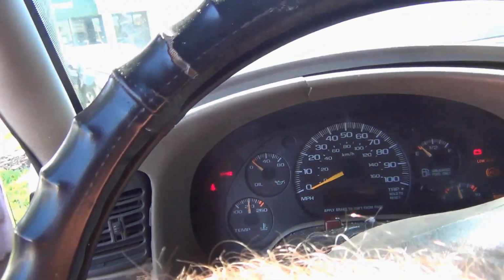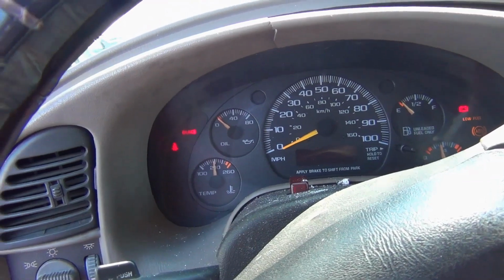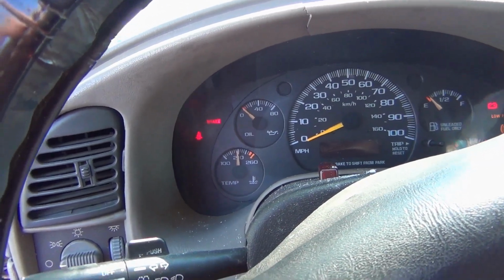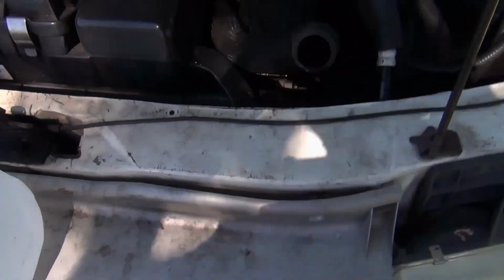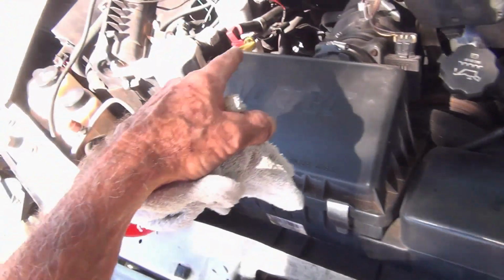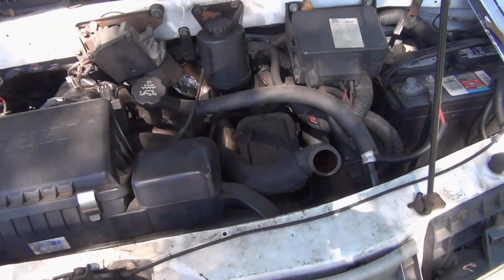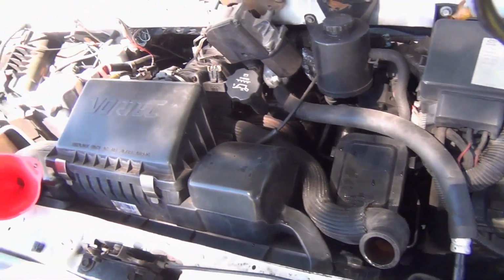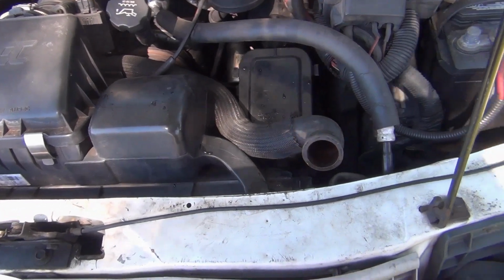Well, it's come down from the red. If I pull that top radiator hose off and pour in a gallon of this cold water, it'd probably cool it down pretty good. So I pulled it out of there so it can get in there. It's slow and it's running out, but not quite as fast. So that should cool it down. Like I said, I'll leave this out, leave the hood unlatched. Got another full gallon if I gotta jump in there.